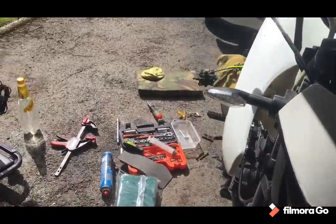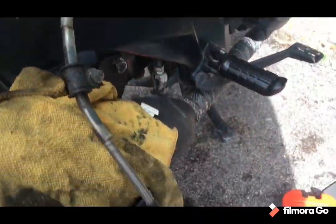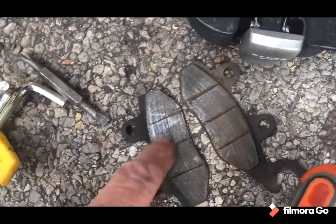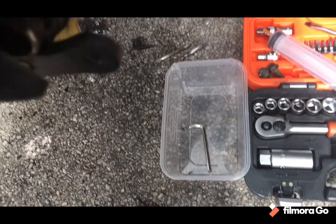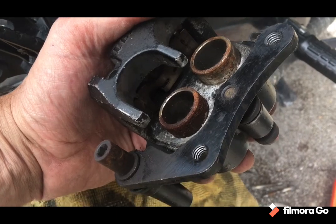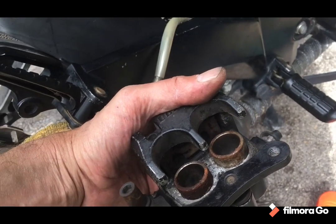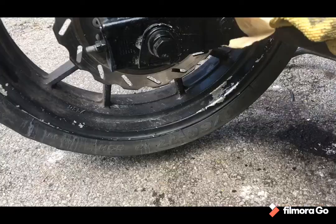I can't put off the brakes any longer, I've got to do them. Taking the back one off - it's all still sealed, a bit loose. Got the brake pads out - not actually too bad, but not usable because it's gone through the lining. I'm going to order some new ones. Not looking too horrendous overall. The outers are looking a bit ropey but I'm going to give those a look over and see how I can get on without taking them all the way out and re-bleeding.